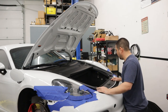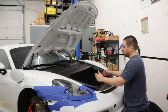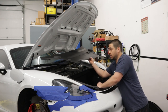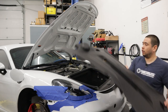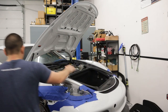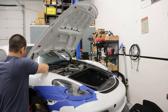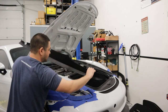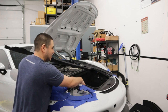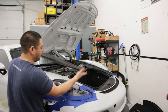Pop the frunk, and what we're going to need to do is get to the bolts in the front of the bumper. In order to do that, we have to take all these plastics off. They're all removed by just the interior trim clips or panel clips. Pull the rear center one off first, and then work on the sides. For the side pieces, you will need to pop a clip out from the rear portion, and then as you get towards the front, there is a T-slot kind of thing coming out of the car. Pull this towards the rear of the car and the rear section will come out.